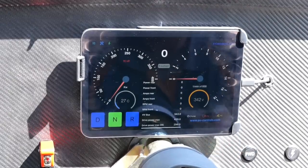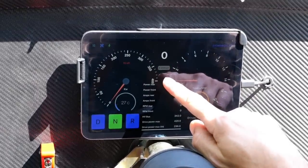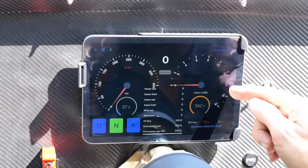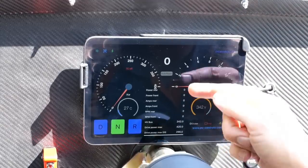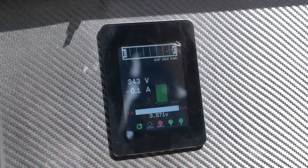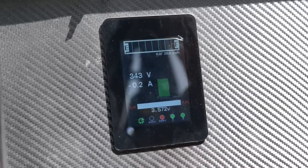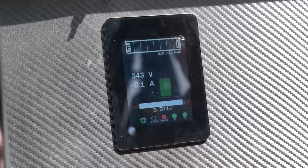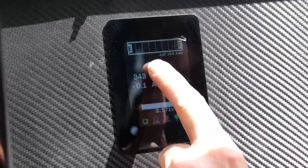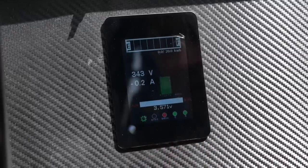If I put my foot on the brake you can see that goes red — that's confirming it's getting the brake signal and gives additional braking assist through regenerative braking. Over on this side you've got revs of the motor, pack voltage, and other information — but 99.99% of the time you're not looking at that, your eyes are on the road. On the left hand side of the dash we've got the battery management system display from Dilithium. This is for diagnostic purposes — if there's a problem with the BMS it'll just shut the car off. The top bar shows the kilowatt hour battery pack size; we haven't set that yet so it's showing 20 kilowatt hours, which it is not. Battery pack voltage is 343 at the moment.